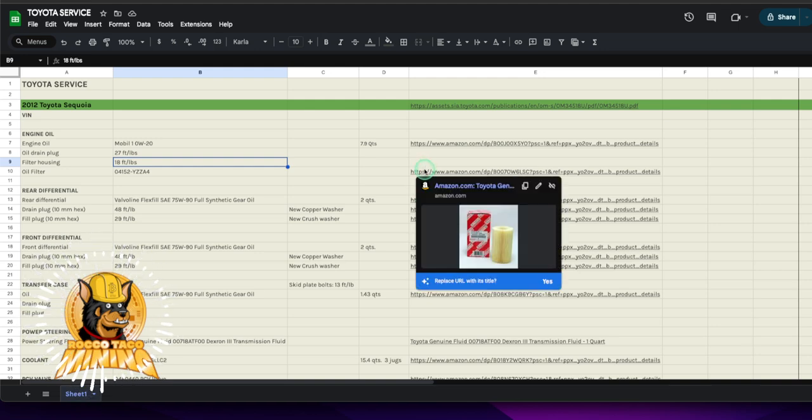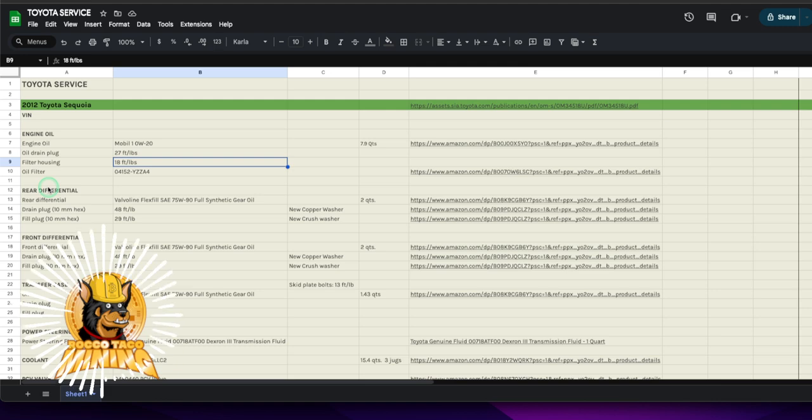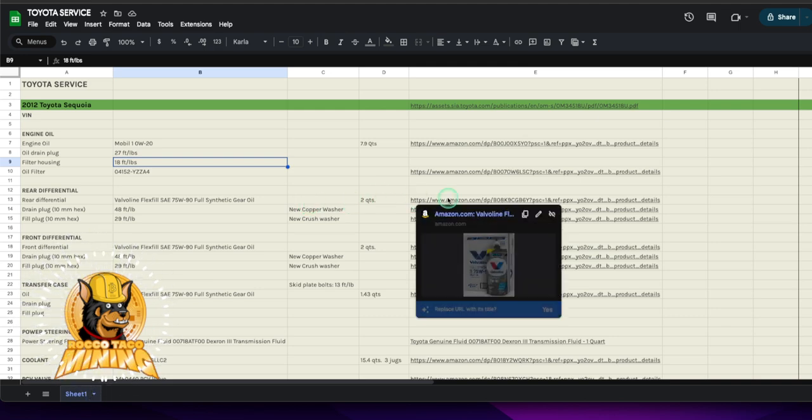Keep them dry, clean, and stored — that's why I got the big storage box. I did the rear differential fluid. A lot of prep ahead of time on the drain and fill plug — putting PB Blaster on it to make sure it wasn't seized — then tapping with a hammer before removing. I needed a 10mm Allen socket I didn't have, so I had to buy that. Amazing all the little tools you end up needing.